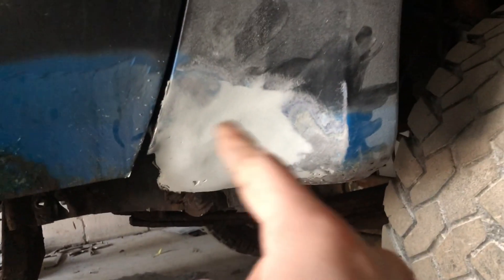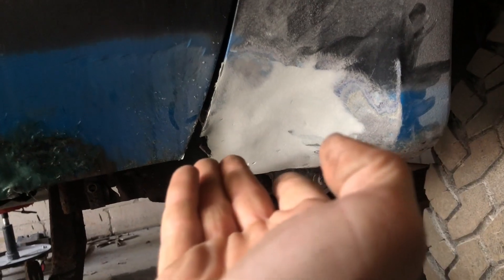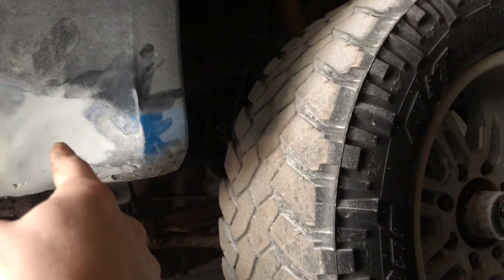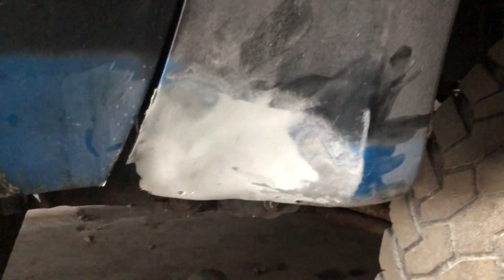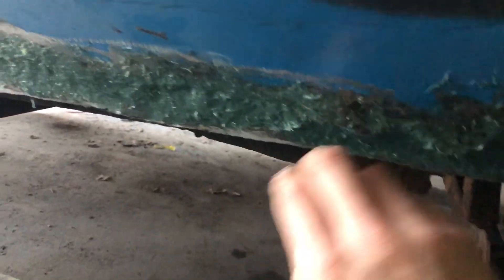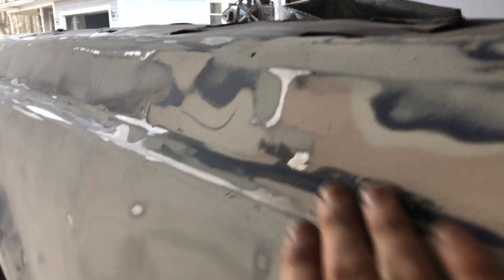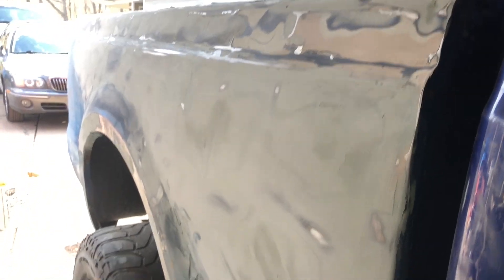Here's that hole I started with earlier — I'm gonna finish off this corner and then chop that bottom so it's flush. I filled this in — you saw it was a big hole earlier — so this has gotten much better too. You can hardly tell it's Bondo, it's very thin, but that's just over top of the fiberglass, and that fiberglass is so strong. I'm gonna get my whiz wheel, knock this down so I can get Bondo over top of all this. Once I get the Bondo over this, I knock that down one time, get a final layer over the Bondo, and it'll be pretty much ready for primer after that. The truck's going pretty well — I'm thinking I'm going to get this whole bed done by the end of the day.